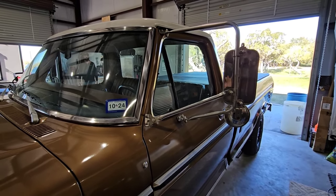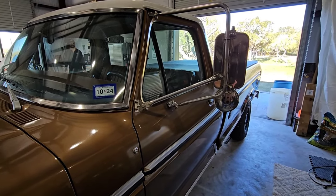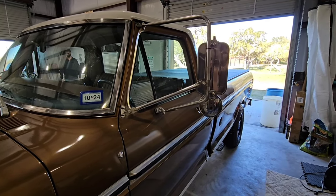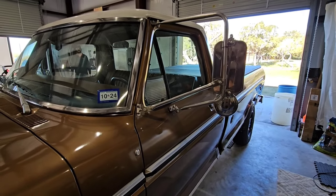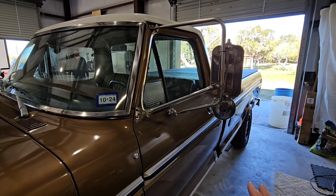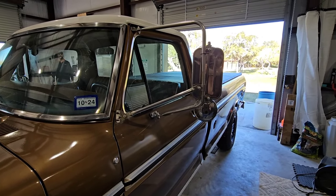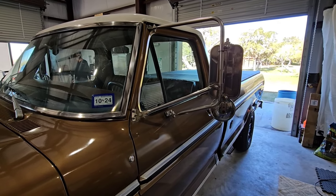And that's actually a pretty good idea, because for the most part, the interior panel of these doors do get wet. Water comes in, goes down the glass, and gets behind there. So I don't think you have to worry about any rust or corrosion in a way that you wouldn't normally have to deal with on any pickup truck. But there are definitely areas up here and right here that normally don't get wet, and you don't want water to accumulate, but it's still going to be able to flow down. You could always put a little dab of silicone on the back of it and plug it in so it's removable, but at the same time, watertight.